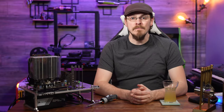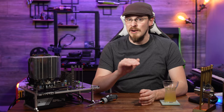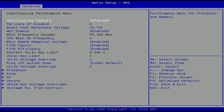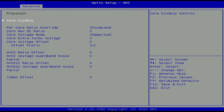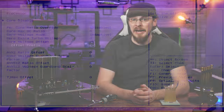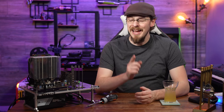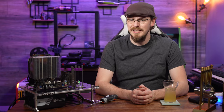After quite a bit of tweaking — most of which pushed the CPU far beyond 80 watts and into instant crash territory — I landed on a 75mV undervolt and an unlocked turbo clock with a max TDP of 72 watts. Even under extended Cinebench testing, CPU package power hovered right around 65 watts. We managed the same scores as our early tests in both single and multi-threaded runs, and hit a max temperature of just 69°C.